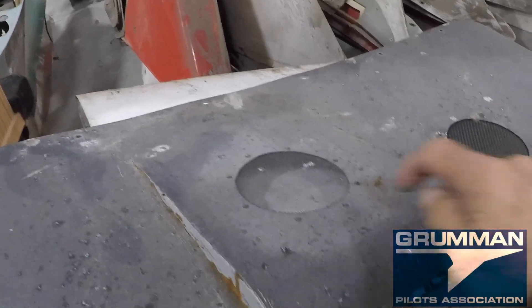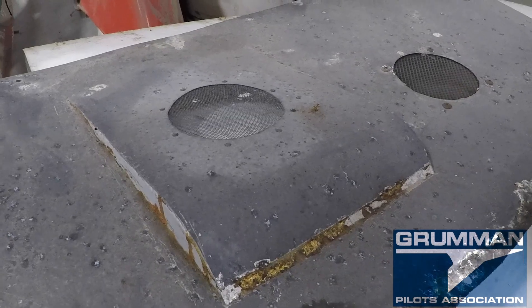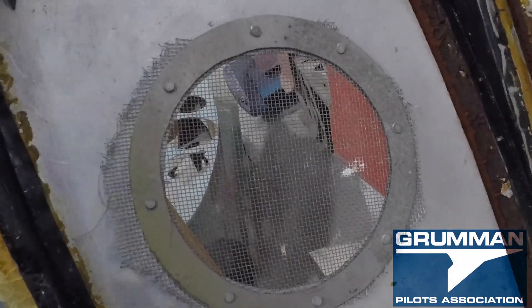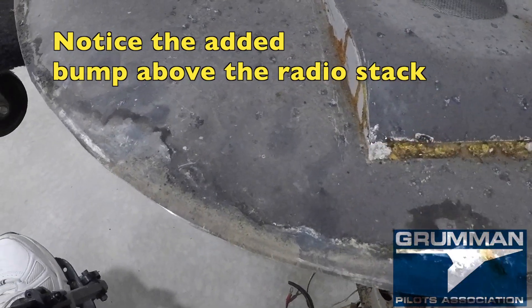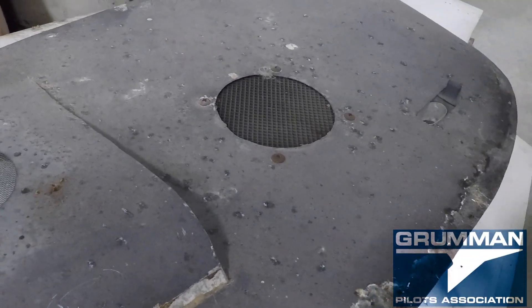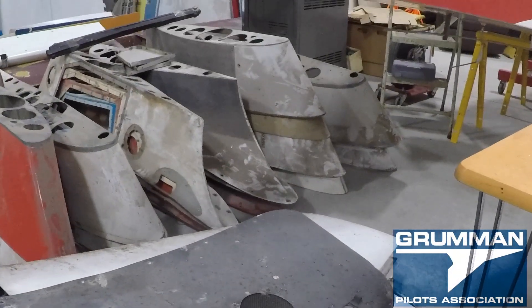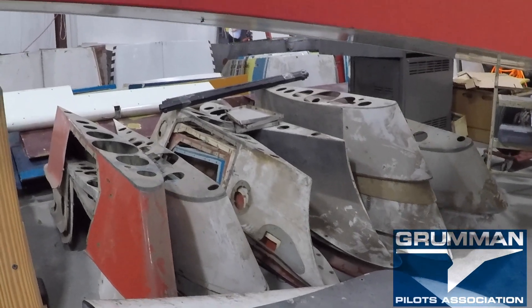As you can see from sun fading, this is the black metal glare shield on our panel — the dashboard — and it's just a single piece of metal, hardly any corrosion on the backside. There's the speaker grill, the other venting grill, your defroster vent. But the black paint — you can see the corrosion where the paint has come loose where the tapes were. This could be cleaned up and reused, but it's taking a hit from sitting in the sun for 41 years. So much for letting your airplane sit — it doesn't do it any good. Not to mention what it does to the engine, so let's go look at the engine.